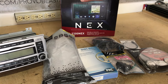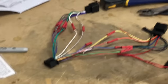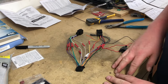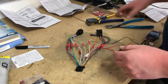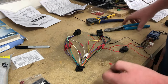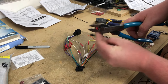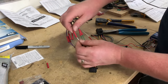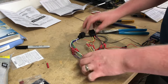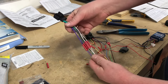The first thing we're going to do is pull out our wiring harness from the Pioneer and start matching colors up with our wiring harness adapter and steering wheel control. If you're comfortable soldering and using heat shrink, that's the preferred method. Otherwise you can use the crimp method — just get a good crimper and wire stripper, strip both ends, and crimp the wires together on both ends. Match color for color all the way through.